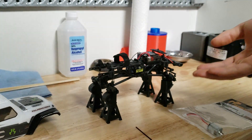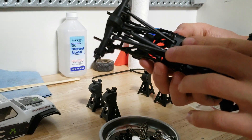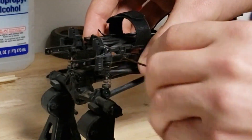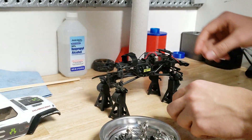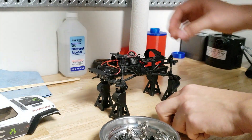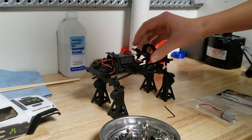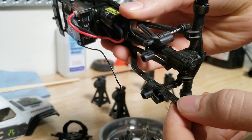I would suggest taking the tires off too - that just makes it easier and it's not that hard. So next step is we want to get the transmission out of the truck. But first let's remove the battery tray and take out these four screws, two on each side, holding it in. With all the screws removed, you just pop this out. It is a mini c-channel frame as you can see, so there is a groove in there.